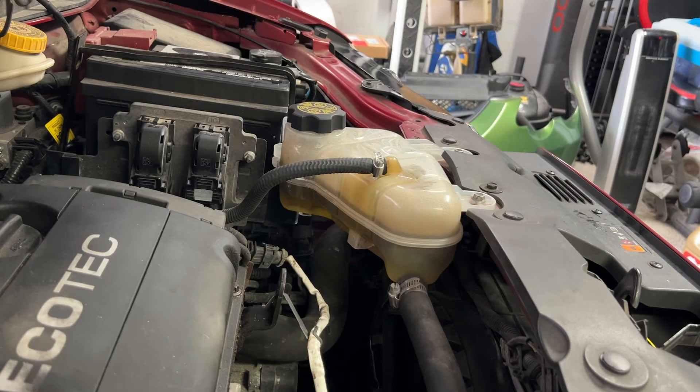The car has been sitting, it's cooled off, and the system is pressurized. We're going to do the same thing over again — release the pressure, remove the cap, start it up, and give it a little bit of gas. Let the system run through to get out any remaining air bubbles, then top it off and get the car up to temp to make sure everything's good and there are no leaks.